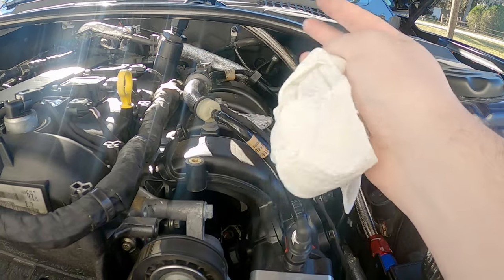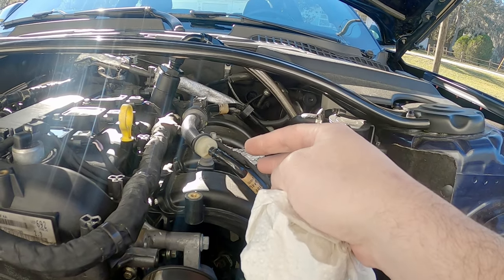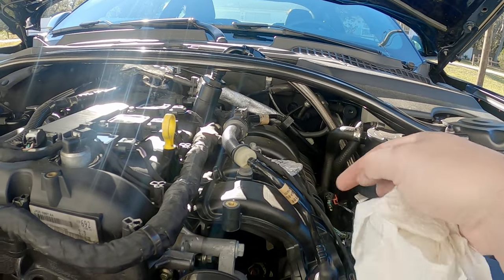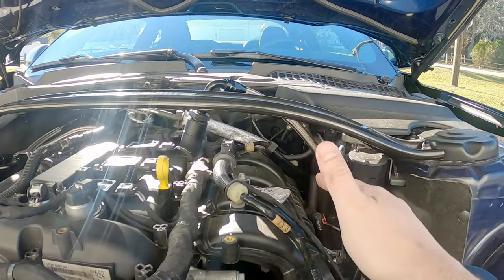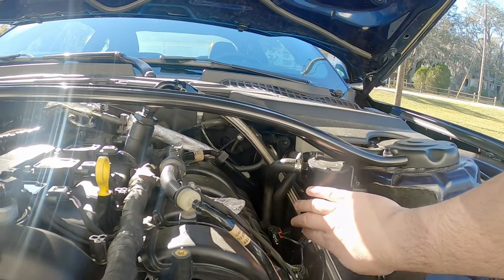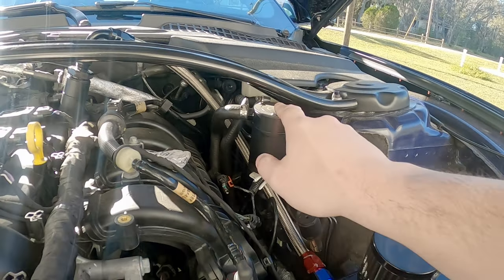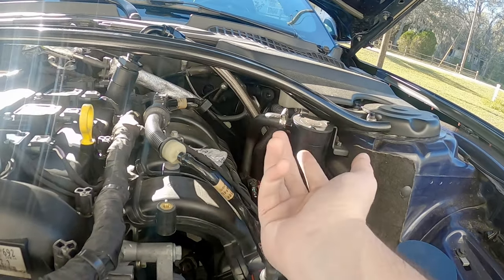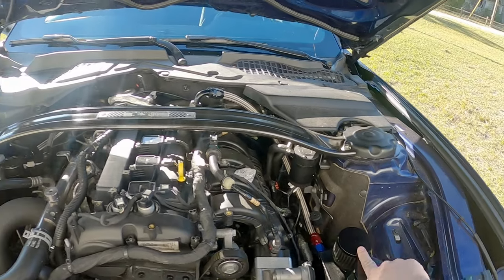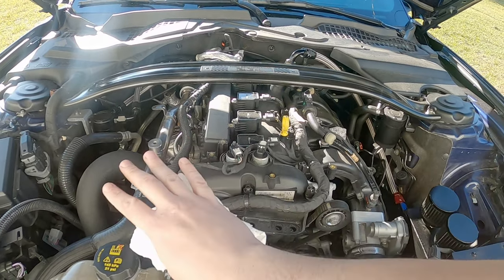Tis the season. At some point I may upgrade the baffle plate to an aftermarket one — I just didn't want to spend $130 for a piece I didn't think I needed when a factory piece new is only $30. That may be something I'll upgrade in the future, especially when I start running more boost. I may actually run the baffle to a breather like this instead of a closed can. But for now, this is definitely an improvement — oil is coming in here, nothing's over there, so this whole line should be dry going into the turbo, keeping everything good and clean.